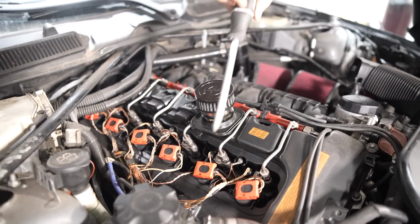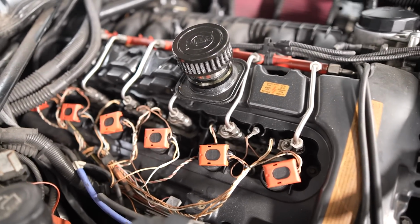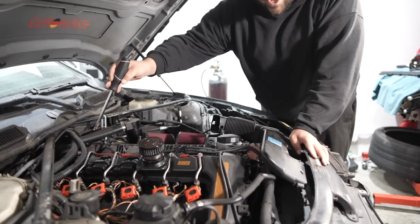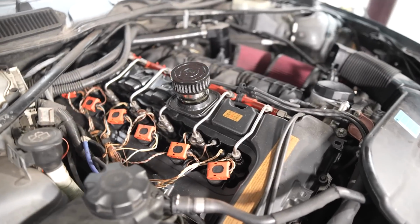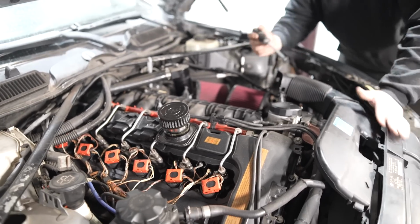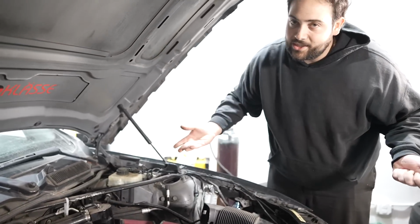This thing is puking out oil, so all along the valve cover there's tons of oil. It looks like someone has RTV'd around this valve cover gasket, so like it has some attention brought to it. There's RTV spewing everywhere out of it. I mean, we got a rat's nest of problems. Like, this thing is not drivable.